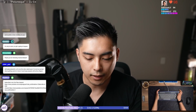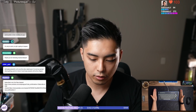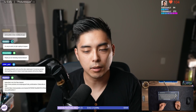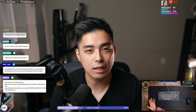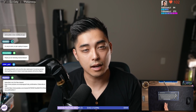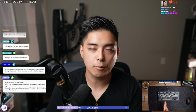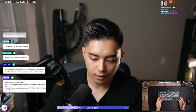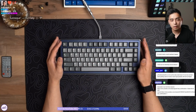Why? Because I get the F keys to use as macros. I get this large keyboard, heavy keyboard, and I like flexibility. I like plateless boards. I like half plate builds. I like flexibility. I don't like stiffness all that much, but often a gasket mount board kind of gives me a subpar sound. Here it gives me a really full sound with flexibility, with the option to do PCB mount or PCB foam, case foam. And I get my arrow keys back, get my navigation. This whole thing is really easy to use.